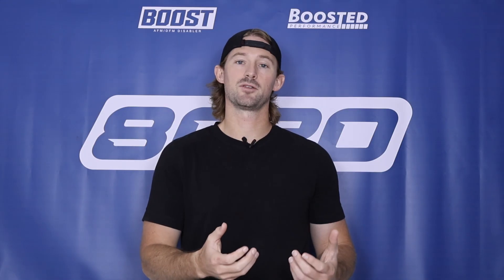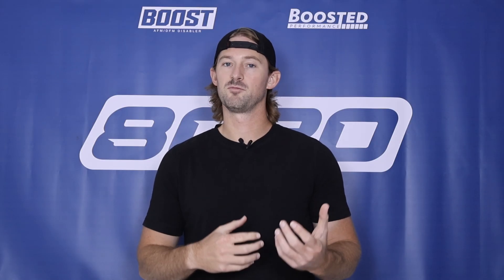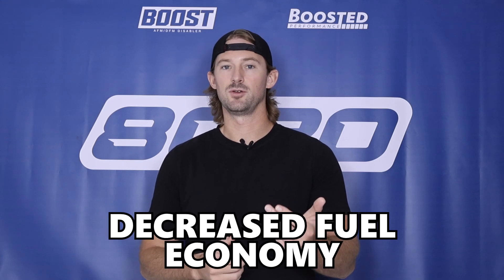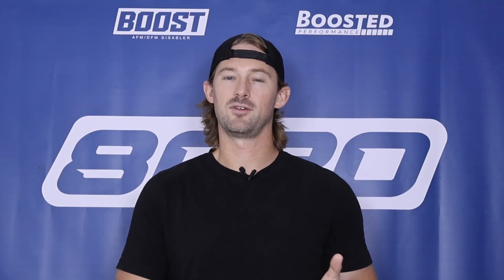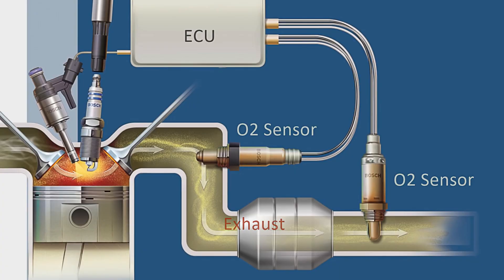These sensors are also used to control things like air-to-fuel ratios. So when your oxygen sensor goes bad you can have a number of problems with your engine like rough idling, hesitant acceleration, decreased fuel economy, and other things that make it feel like it's just not quite running right. That could be because the engine is compensating for the bad reading it's getting from the oxygen sensor by putting more or less fuel into the combustion chamber.